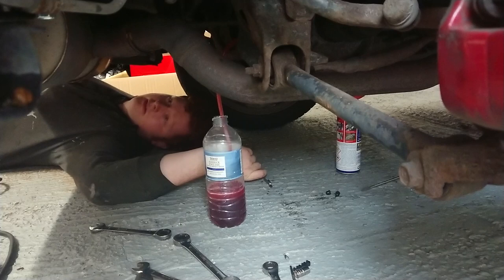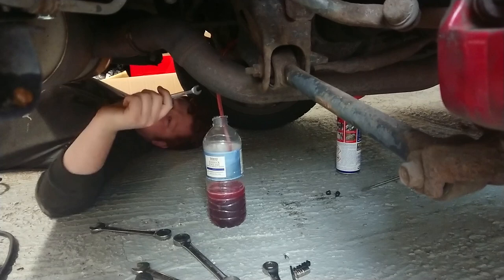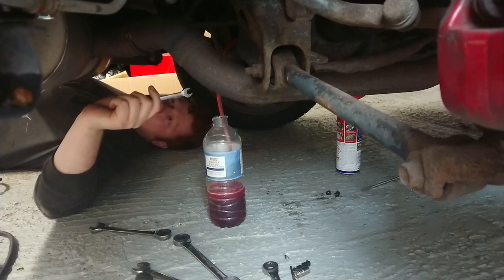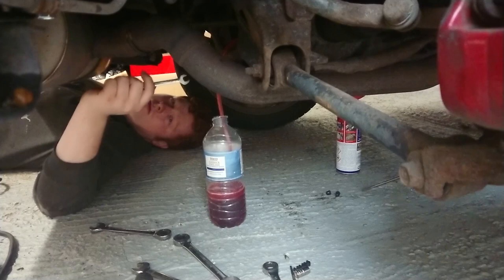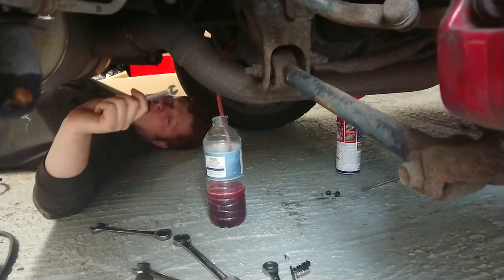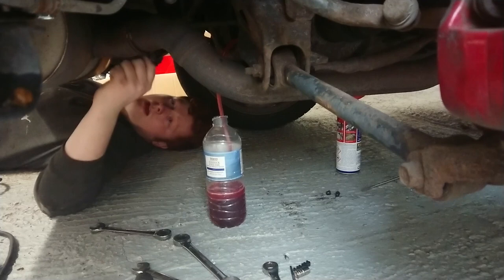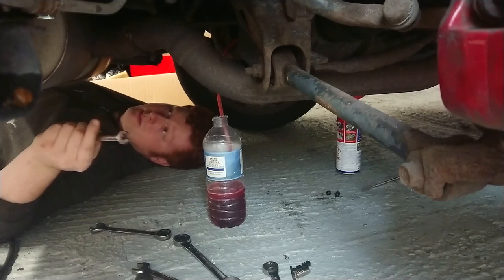Just something to bear in mind: I thought all the air would come out after about three or four seconds. But when I bled it again I actually found there was loads of air left in the system. Obviously when you're bleeding, it's got to push through the old fluid, then the air, then the fresh fluid comes through. So just because you see a solid line of fluid doesn't necessarily mean that you've bled the system. Just buy a gallon of the stuff and push a whole litre or two through each loop so you can be absolutely sure there's no air in it. I'm confident now — I've put a few litres through and there's no air left. When you're underneath the car you can actually hear the air bubbles going through the loop.